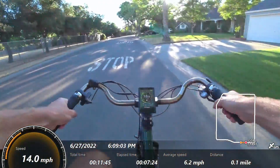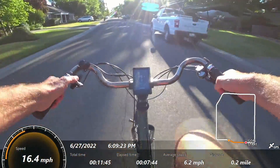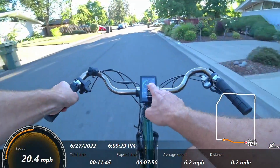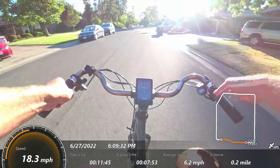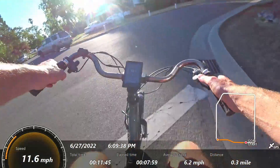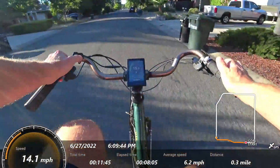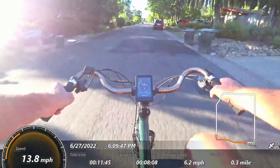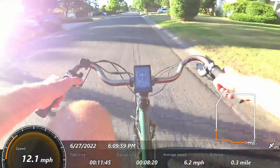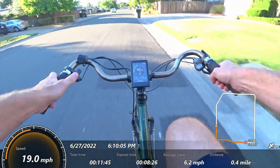I'm here in assist level 4 and this isn't even with a fully charged battery, so maybe it isn't the best representation. You can see this particular display actually gives you a little current watt usage indicator. It doesn't seem to be very accurate especially in lower output scenarios — I can actually feel it putting out power in assist levels one through three and it still registers zero. So it's not ultra accurate, but it can give you a ballpark figure. It's nice to know how much you're drawing at a given time. Alright, we're gonna go up to level nine that way you're not restricted in any possible way.